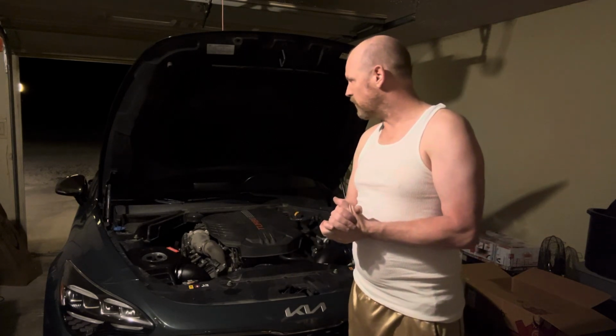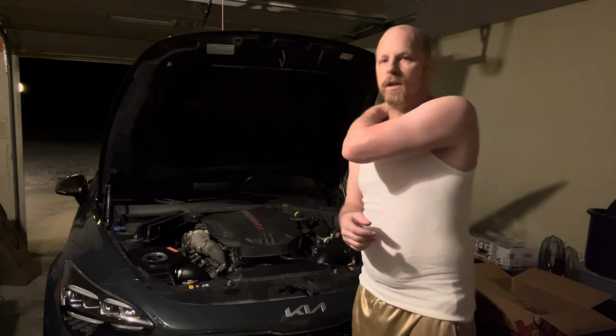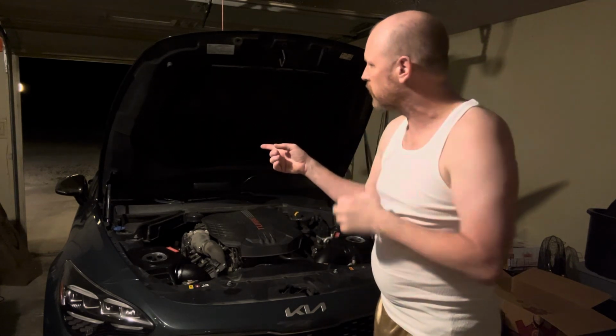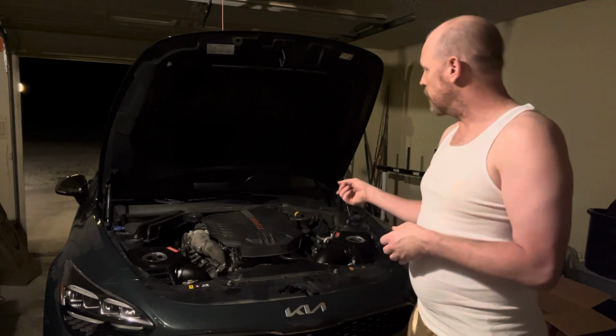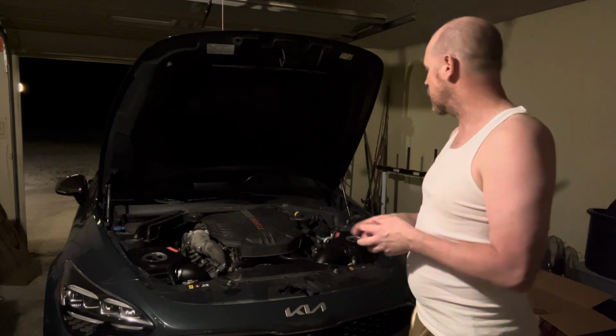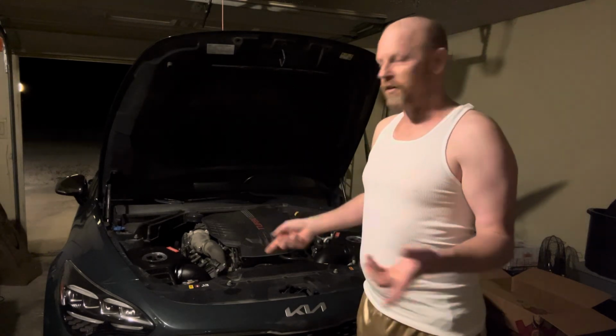And so anyways, just to let you guys know some future videos, I've got some lowering springs over here. I've got the intercooler there. The reason I got that particular one, I think it's a BMS intercooler, is because it has the bung on it for the CPI kit, because I am going to do the CPI extra 7th injector, and then get the flex fuel kit because I'm going to run E85 eventually. I'm going to put downpipes on it, the ones that come right off the turbo. And I don't understand this new language that people have, where they say I've got downpipes and then it's the mid pipe. It's not even the downpipe off the turbo. I don't get that, but whatever. I'm doing the ones that come straight off of the turbo.